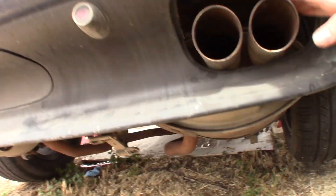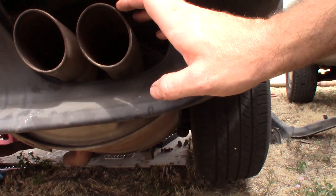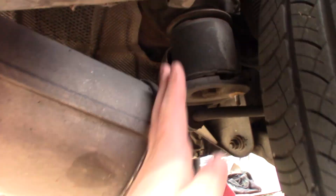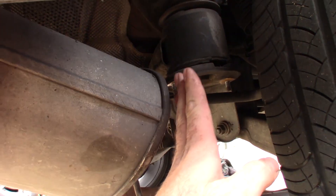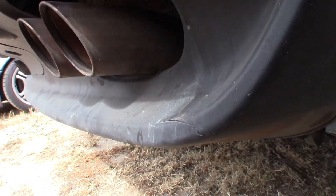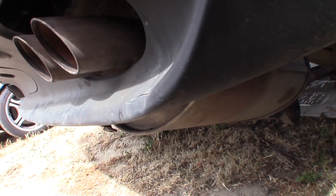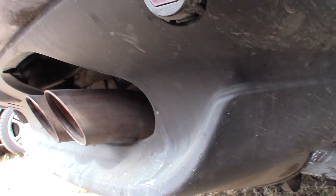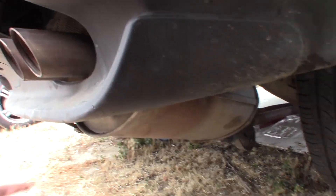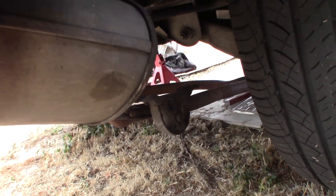There's just not enough room for the back mufflers to come out — there's the frame of the car right there. There's not enough room to pull them forward so they clear the bumper. You would have to take the bumper off if you wanted the clearance to drop the whole exhaust together. So these are the brackets for the rear exhaust right there. That was step one.